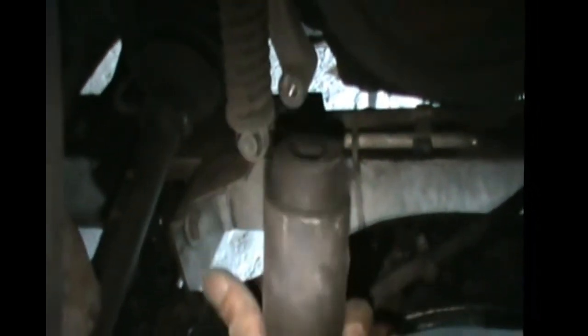And the way I'm going to do it is I'm going to use a jack. I'm going to put a jack under here and lift it up. I'm going to have one of my sockets, one of these sockets on top of the jack, and as the jack goes up, it'll hit this thing down here, so it'll go up on it like this. So it'll go up on it and keep pushing it up till eventually that hole right here will align with this, because it's getting pushed by this socket up slowly. And once it lines up, I put the bolt in, tighten it, and I'm done.